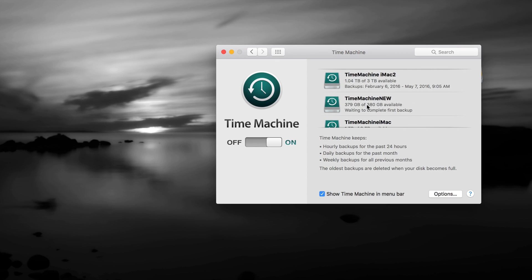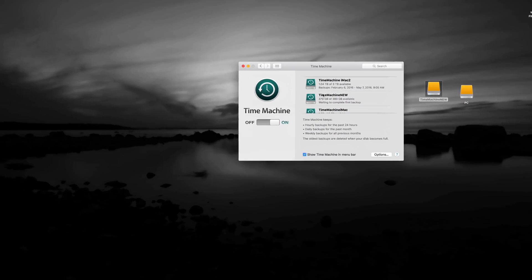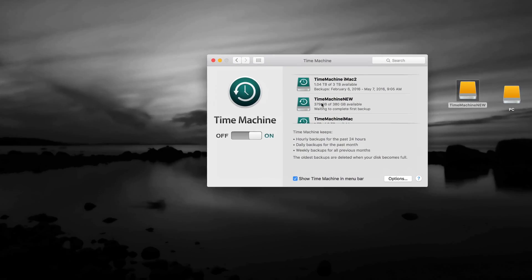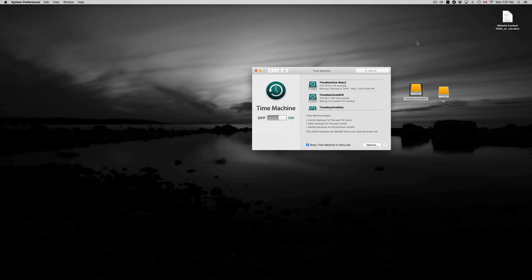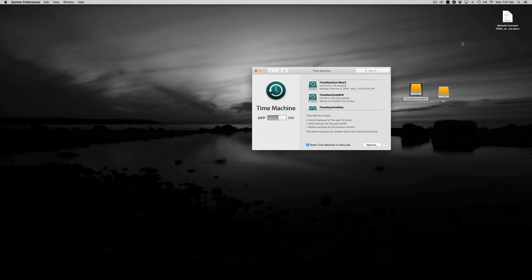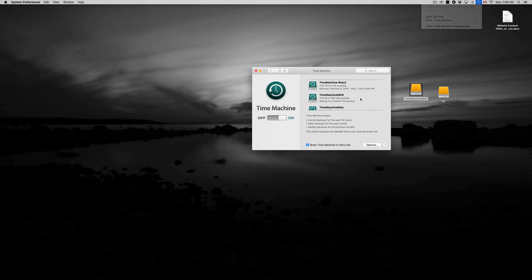Choose the Journaled partition — in my case 'Time Machine New' — and click Use Disk. You should see it listed now and it will say the backup hasn't been done yet. Your drive icon may change from yellow once the first backup completes, but if it doesn't it's no big deal. Make sure you have a checkmark next to your drive, then go up to the menu bar icon and choose Backup Now. I'm not going to do it right now because it takes a while — you'll see a loading bar and it will start your first full backup of your entire computer.